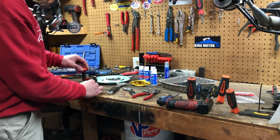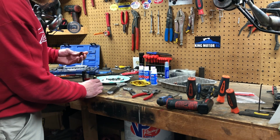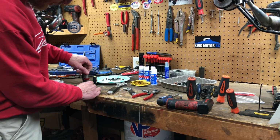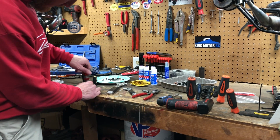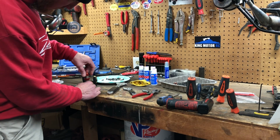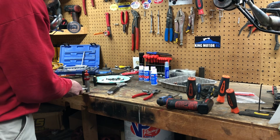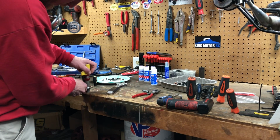So we're gonna go ahead and put this cap on. And I fill mine clear to the top because there's this bubble little thing in here that's gonna, as I tighten it down, squish fluid out. So that should guarantee me absolutely no air in it. Okay, and we'll grab our Rovan wheel nut tool and shock absorber tool.